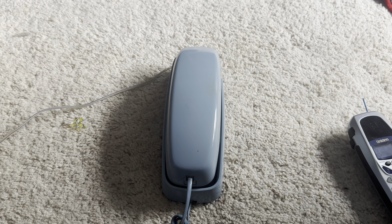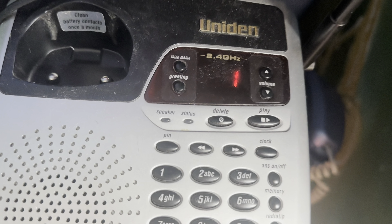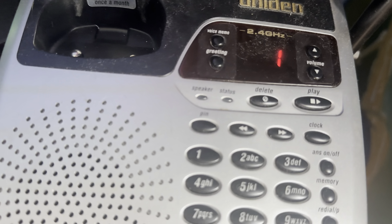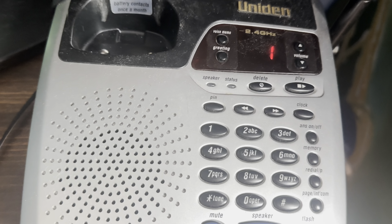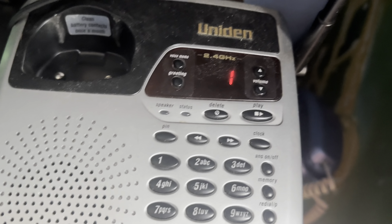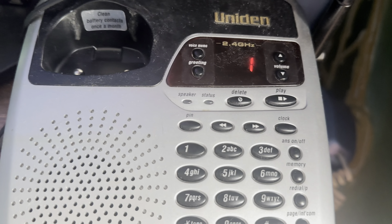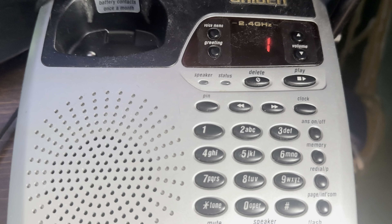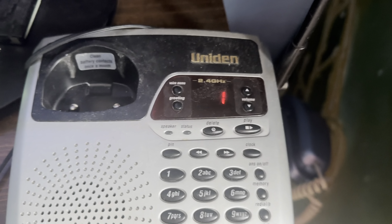Let's do a DTMF test. The older AT&T phones were a mechanical keypad, which means if you press two numbers at the same time, you'll get one little tone that is used to generate DTMF. DTMF usually uses two frequency tones to make the numbers, but if you press down two numbers at once, it will only play one of those tones. So here we go.